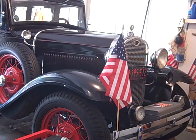First, you have to make sure it's safe. So let's go through some of those things. It has to stop in a decent fashion, and the steering must be sound. Don't drive it over 10 miles an hour if the tires aren't good. If in doubt, ask someone who knows tires, but you don't want to have a tire failure on the rear of a Model A. It'll twist you around so fast, and if you're going fast, it's not a pretty scene. So make sure you have some good tires on it. You can get tires a lot of places, and they're not expensive.